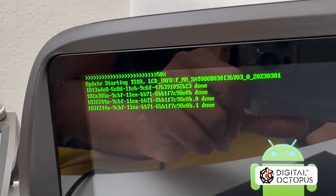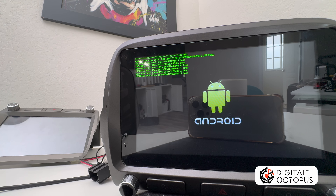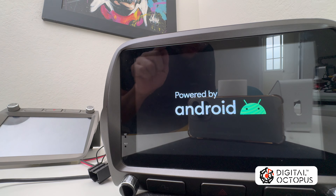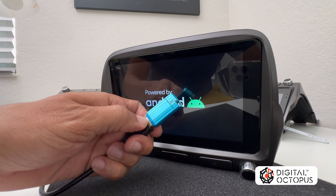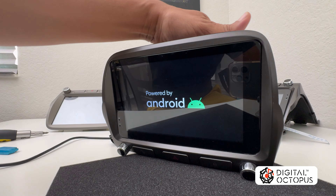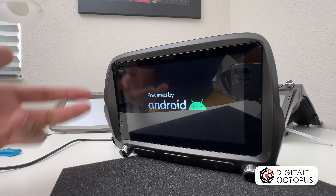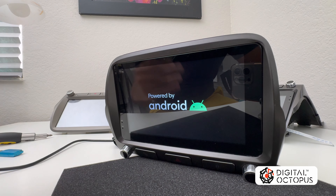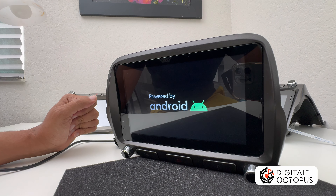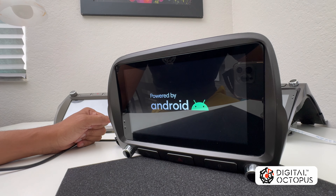What we're going to do is hold the Key 1 wire against a metal part on the radio — I like to use the GPS antenna or the Wi-Fi antenna. Just hold it there with your finger; it's not going to electrocute you or get hot. Then go ahead and turn the car key to the 'on' position. The update progress will appear — it jumped to 50% at 125, so give it some time. After 75% it usually goes very fast, and then it will say 'Update End' and the system will restart itself.